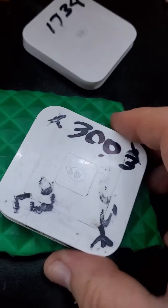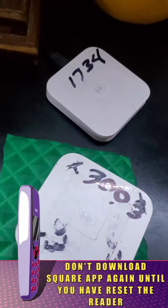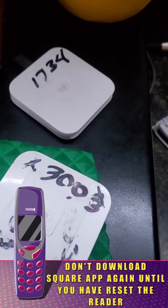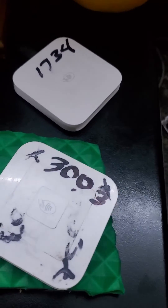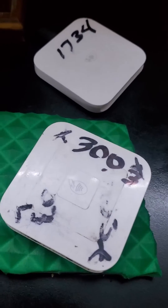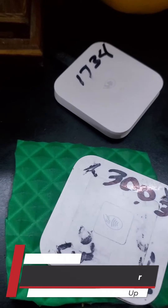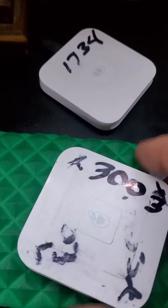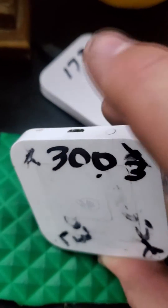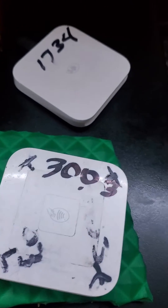What that has done is totally reset your Square card reader. Now you can go into your Play Store and re-download the app. Make sure you've cleared out everything that has to do with Square — make your phone forget that Square card reader. Then, once you've re-downloaded Square, hold in on the button again until it flashes yellow and it starts to pair with your phone.